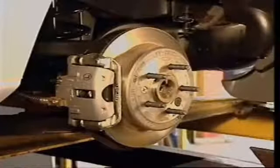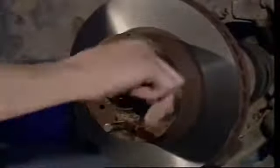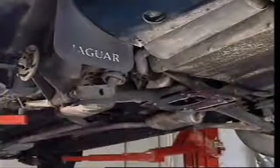On driving wheels, the disc is mounted onto the driving axle and may be held in place by the wheel. On front wheel drive vehicles, it can be mounted on the front hub and wheel bearing assembly. The brake caliper assembly is bolted to the vehicle axle housing or suspension. In most cases, the brake is positioned as close as possible to the wheel. However, this high-performance car uses inboard disc brakes on its rear wheels. Its makers claim improved vehicle handling for this design because it reduces unsprung weight.